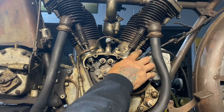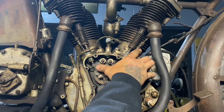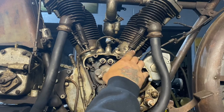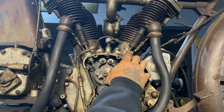As I roll over right now, here comes the front intake stroke — you can see that intake push rod opening. As that cylinder closes, the rear starts to do its intake stroke. The front piston is starting to come up, and the magneto is going to fire on the front cylinder. After it fires, the front exhaust valve opens.